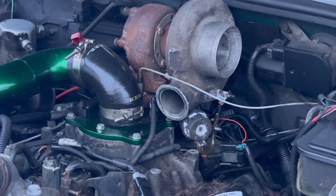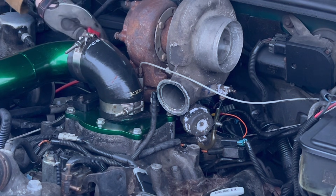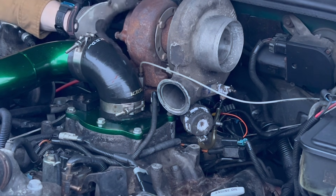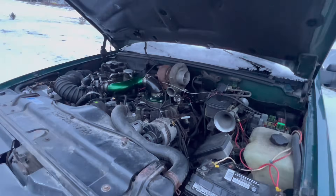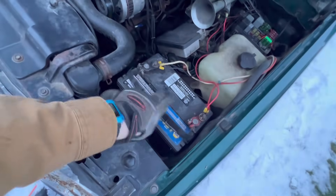Which means I'm going to have to probably find a better way to tuck this sucker in here. I've got the HX35 kind of slid in — it's a little wedged. My trans dipstick is going to be a bit in the way. Fuel filter head is going to have to get relocated. Downpipe is going to have to get modified to go over to the factory downpipe. The air intake is going to come over here, and I'll build a box right here.